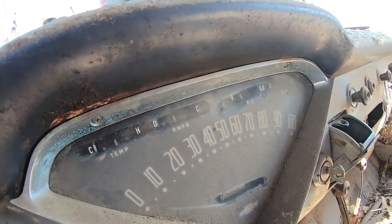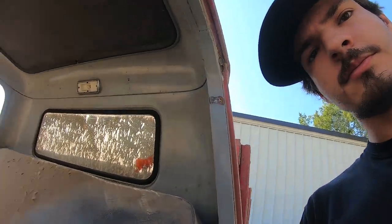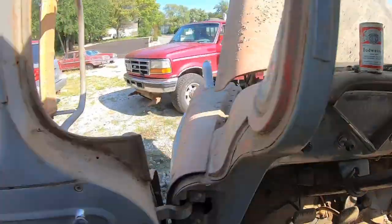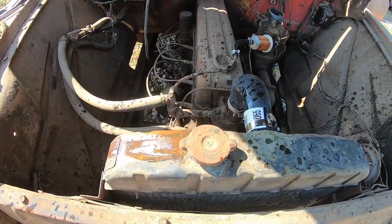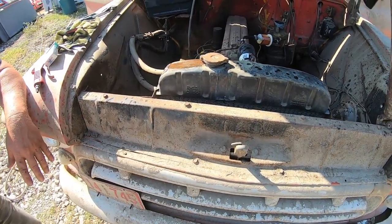For like 15 minutes, temp is sitting center. I just added a little bit of coolant. She's running like a top. I think we're gonna go drive it around soon. All right, the thermostat just opened. She's just a little bit above half. Just capped it. It was spilling out and shooting around, so we know she's flowing. I think you should have left it open.